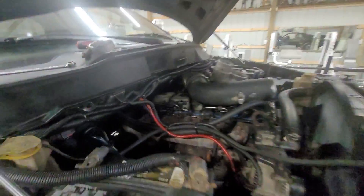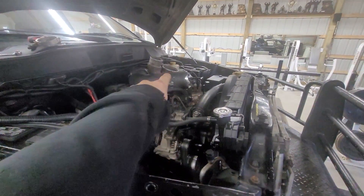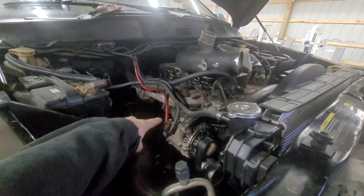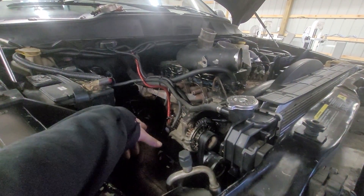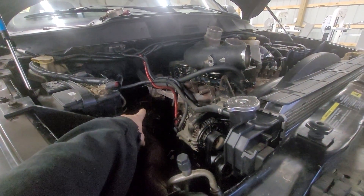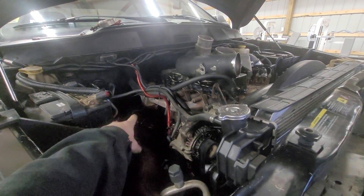One thing I really love about this turbo is how easy it is to actually pull out. The compressor cover is held on with one V-band clamp. The intake comes off pretty easily - 16mm on the inlet, a screwdriver and a flathead for the drain. It all just really comes right back off. It's 11mm for the front compressor and 11mm for the center section.